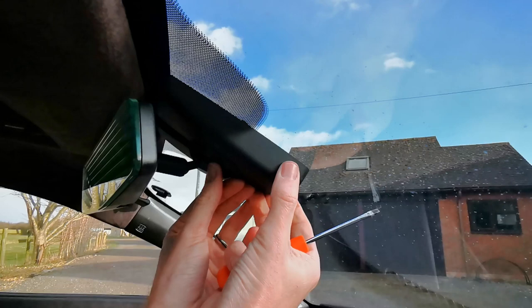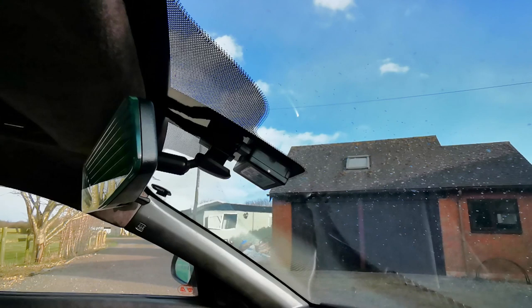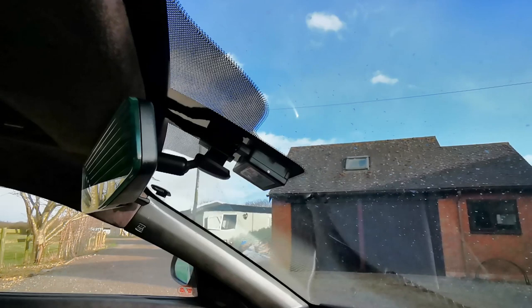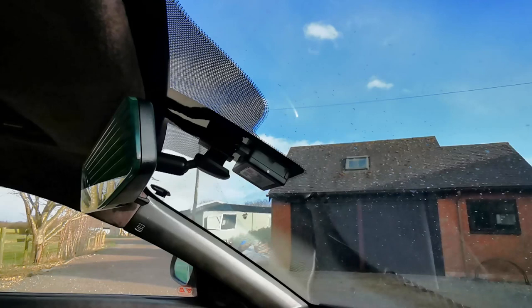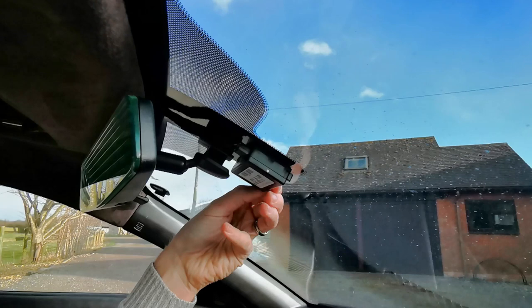First things first on the R3, you pop off the plastic cover from the rain sensor. It's really easy to do — literally a flathead screwdriver in between the two panels and they pop apart. As you can see there are two little plastic clips in there and they literally just click together. On the Series 1, I believe you don't need to do that, but obviously please have a look. On the R3 there is the rain sensor for the automatic wipers and automatic headlights. You just pop those two clips out — there's another on the other side. And then that should just swing down like that.